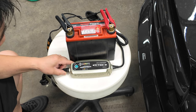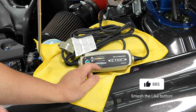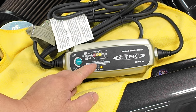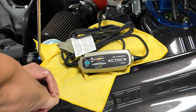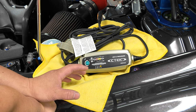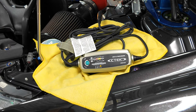We got Jay's car started and we're going to test the alternator voltage — select the alternator test and it says it's good. So his alternator is good. His battery has been dead for a long time and the alternator has been working overtime, constantly trying to charge a battery that won't hold a charge. I'm glad the alternator is in the green.